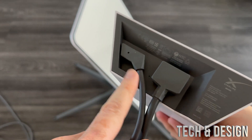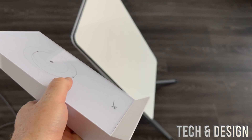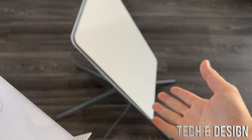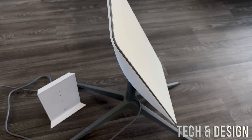It goes in this way and we are set up. The router itself will go inside your house, your RV, or your campsite, and then the dish will be outside — could be on your roof, for example, or on the floor where there are no trees too close. They cannot be way too close, as it's just not going to capture a signal. You want to leave the dish in a space that's pretty open, as they specify that a lot in the manuals.